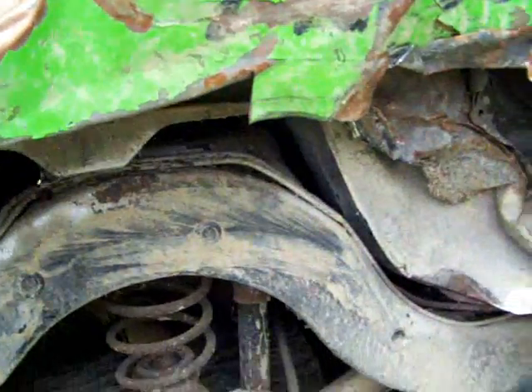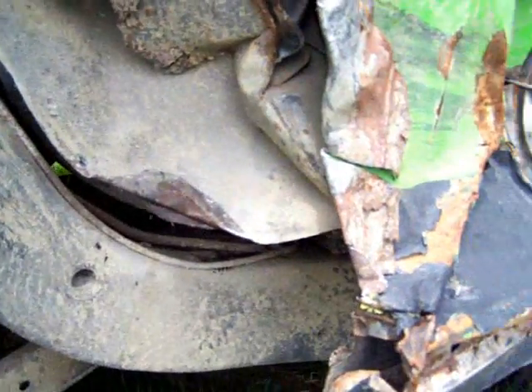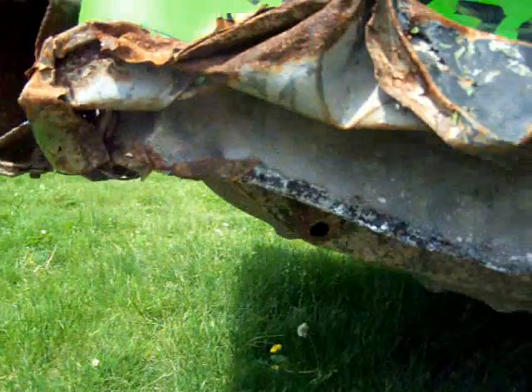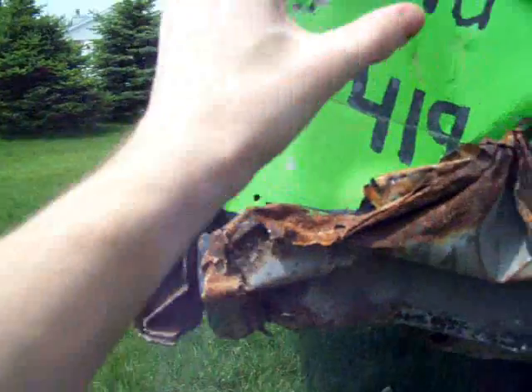All this is just gotten folded under. Here's the frame on our car — still gray, very solid. This car was a good find; nothing's rusted out on it at all, so the back of it's still fairly strong. You can see the notch we cut in the frame — it's just now starting to bend. Look under here, there's the frame curving; used to be straight, but after its last run it's starting to fold up. The idea behind notching the frame is controlling how the trunk packs in. Now that this is folding, after another run or so this bumper will fold up and sit right at the top of the car where that notch is.